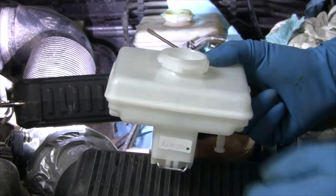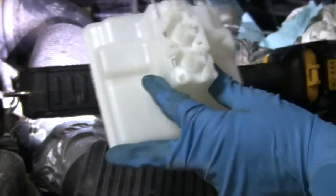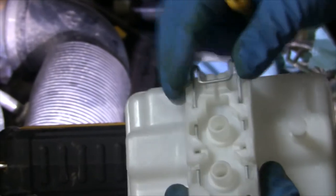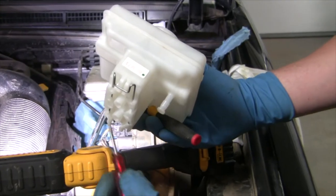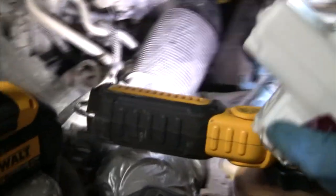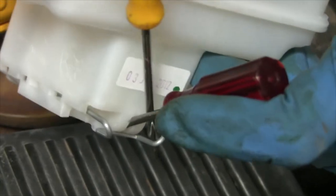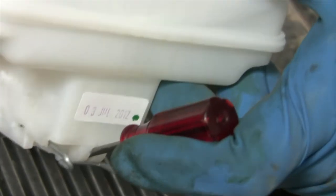Here is the new reservoir — we're going to show how to get this clip off. You can see this clip goes all the way down the length, and these two ports are on top of the master cylinder, snapped into that groove right there. To get it out, there's a keyway but you've got hoses in the way as well as wiring to the anti-lock brake module. The trick is to get a small flat-head screwdriver, stick it into the keyway, push it down, then use a longer screwdriver to reach in from the near side and pry it back — it will gently slide right out.